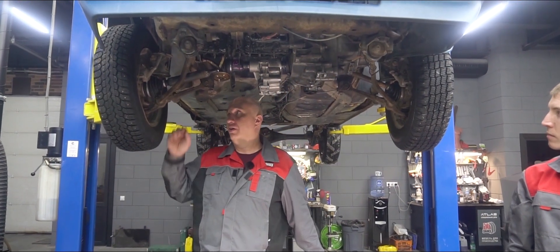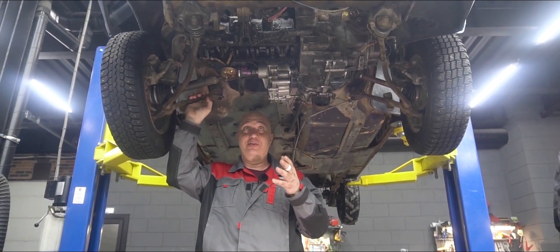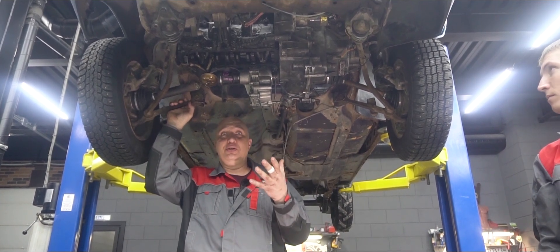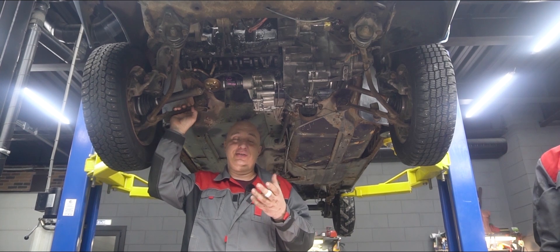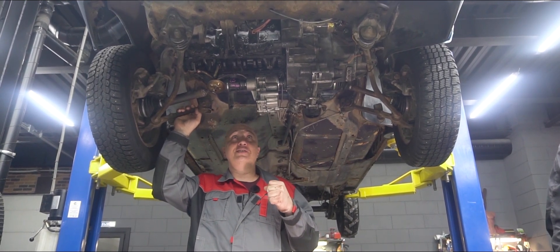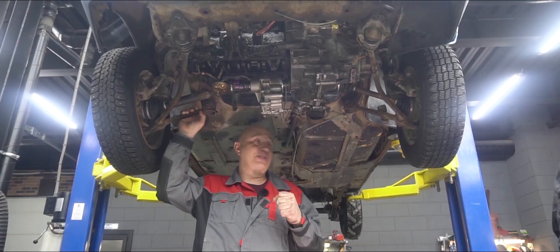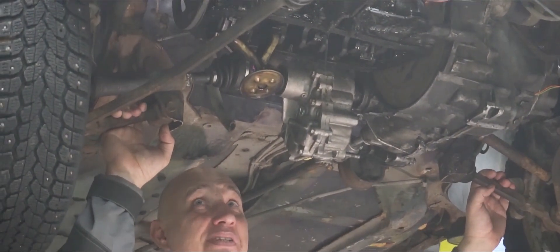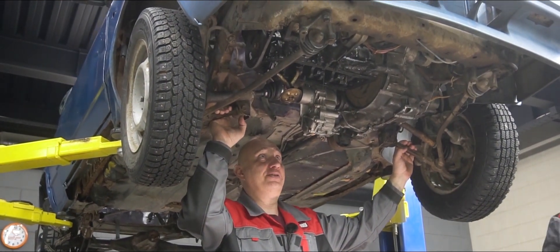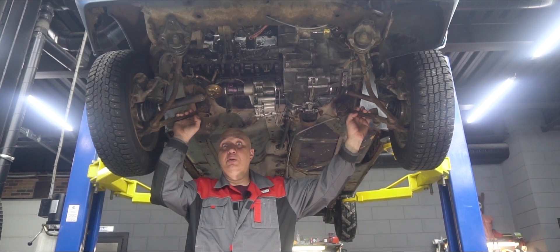We've fitted all four rods with some leather bearings. We're aware that nobody does that, or ever did, or ever will. The belt is quite a bit thicker than those bearings, and when you attach those caps it's a very tight fit. The starter motor is squeaking and screeching, but it does seem to be turning the engine over. We need to get some lubrication going — let's install the sump, fill the motor with some oil, and try firing it up.